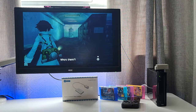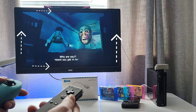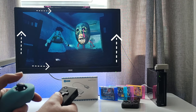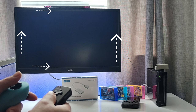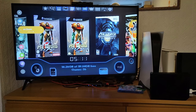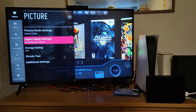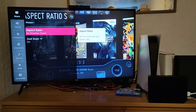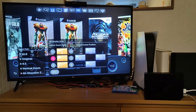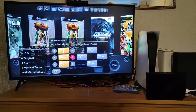But of course, we're not finished there just yet. You may have noticed throughout this entire video that the captured image is not really filling the entire screen. This is due to the original output resolution of the console being 480p and the way the video output is designed from the console. To fix this, the best way is simply to adjust your screen size settings on your TV — I'm sure a lot of HD TVs do have this option available. And there we go — we have the clearest image from the Wii filling up your entire screen.